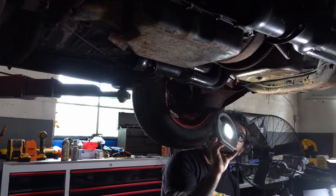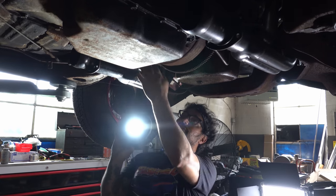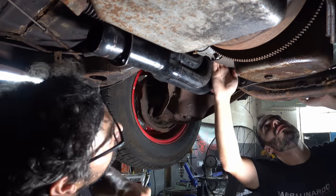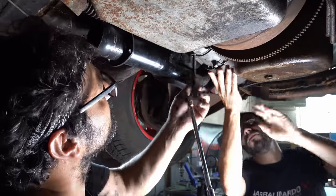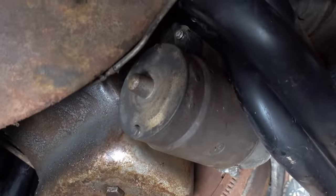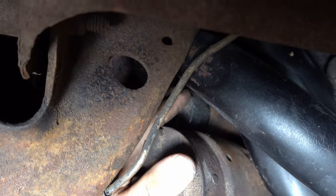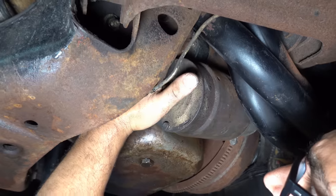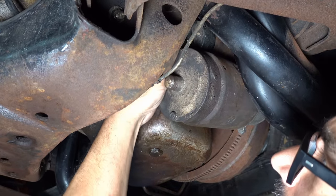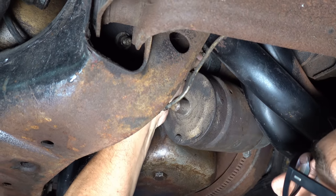All right, back to wiring stuff I can't see or touch. I'm about to drop this starter down, wire it up, and put it back in, maybe. I can't even get my hand up in there. Starter's coming straight down. Well, at least enough to get something on here. Put your hand on it. All right, so there was no contortionist maneuver I could have done to get to this lug. So I lowered the starter out. I can still barely get to it. Put this wire on it, tighten it up, and then I'm gonna put it back up where it goes. My hands don't fit. Come on, get there. Yes.